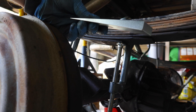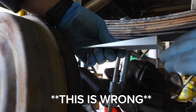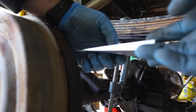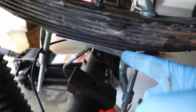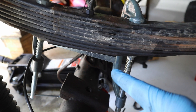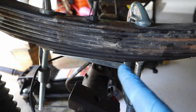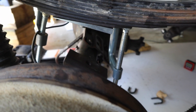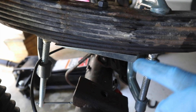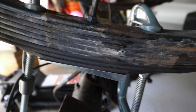Keep in mind when putting this in that we want the thick side going towards the front, because we want to lift up the front of our differential so it's pointing more at the transfer case. Actually — wrong. The way I just put it would point my pinion angle worse than it is — that's six degrees backwards. That is the back of the vehicle, that is the front of the vehicle, and I just put it in backwards. It should be angled this way, so I get to redo that one.